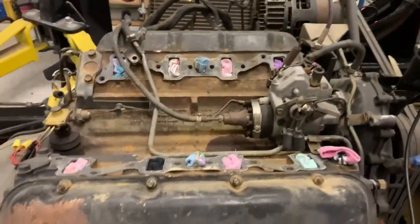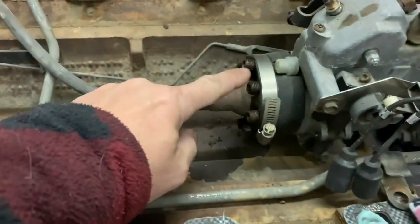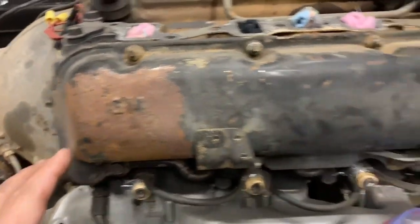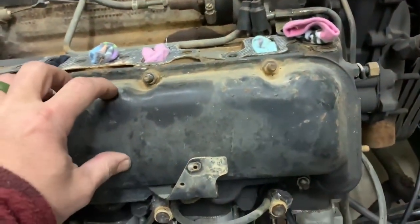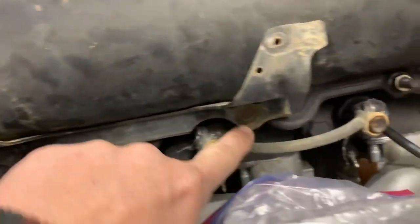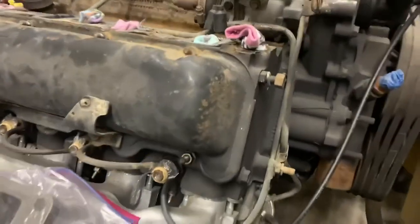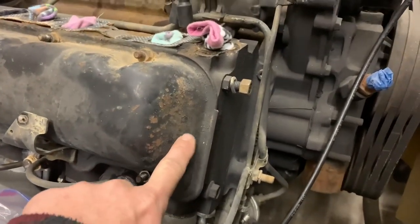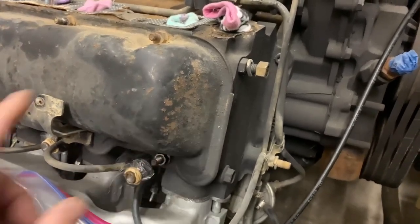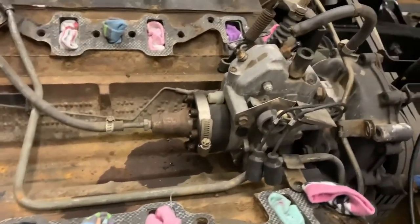At this point I got all the fuel rails coming off from the injector pump. You can see the head cover is accessible now - we're just gonna take some bolts out, loosen this bracket, and I can take this out and get a new one on and put a tap on it. I'll be welding a bung right here for the oil return line coming from the turbo. The injector pump needs to be replaced, so that's getting done, and same thing on the other side.